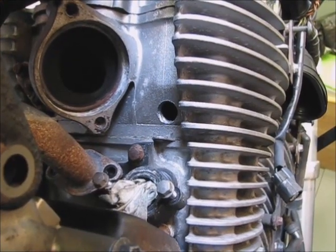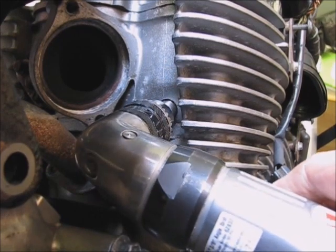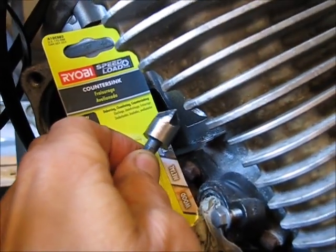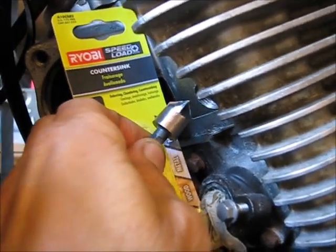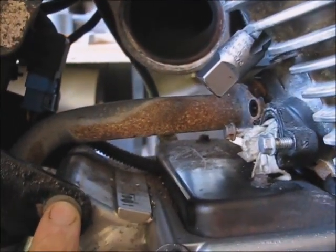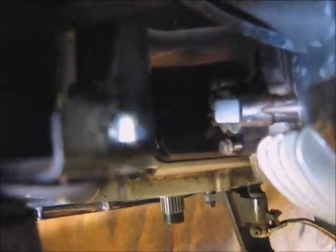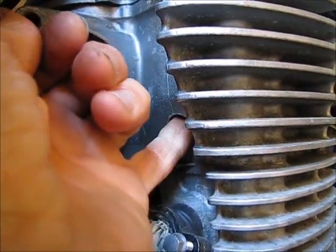I had to drill a 9/16ths hole in the head, so I used an angle drill with a bit that went up in there. I needed a really short drill, so I took a 5/8ths countersink, chucked it in a drill chuck, and ground it down to 9/16ths. This is a 3/8ths tapered pipe thread tap. When I drilled the hole, I lined up the drill with this hole here, and when I tap it, I line up the tap with the hole. After drilling and tapping, you should have someone with a really small finger reach in and remove chips from the far side of the hole.